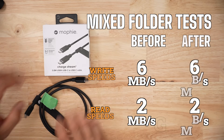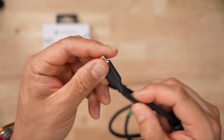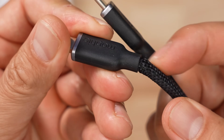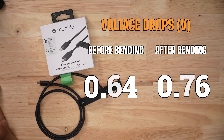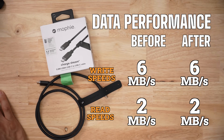At 3,000 bends the performance of the cable was exactly the same as it was out of the box. After 11,000 bends this cable is a lot looser on the bent end compared to the end that didn't get bent, and there is a bit of a bump at the bottom of the head, which is consistent with every other cable. In terms of charging after 11,000 bends, I was able to hit everything but 100 watts. The voltage drop increased by about 0.12 volts to 0.76. So if you're charging your iPhone from dead it's going to add an extra 30 seconds or so. For data speeds for large files and the mixed folder transfer speeds it was exactly the same. So after bending it three times more than what was stated, this thing performs almost as well.